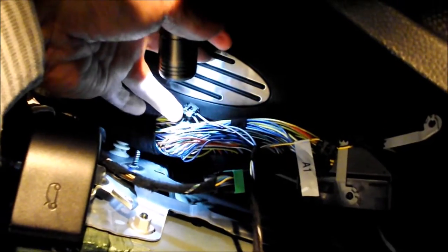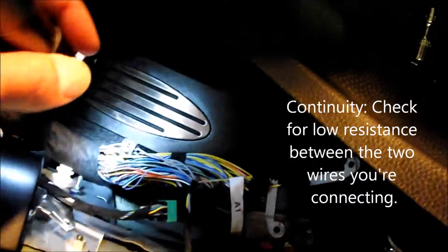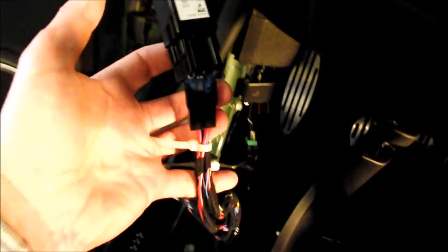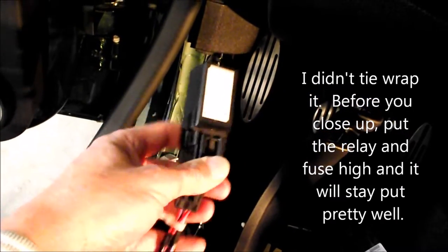Now I've got all of the connections made — the two small ones to the black inserted harness, and the larger one to the gray inserted harness. I made a mistake and put this one too close to the connector; it still fits, but you're better off putting them further up the harness. I checked continuity on all three. I connected the relay module to the harness and that'll need to be stuffed in and tie wrapped, but we need to take care of the switch first before we start putting this away.